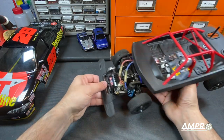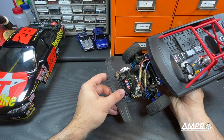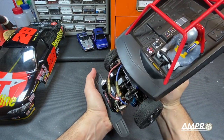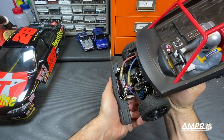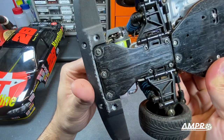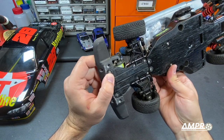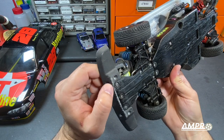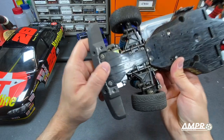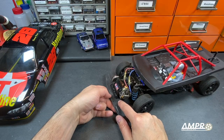Once you've done that, the bumper will clear the motor heatsink if you have one, and it will just slot directly over this plate here. It is not going to be a loose fit. It should be very nice and snug, and just giving it a nice little squeeze here, you're going to get all the holes to line up there and there. This hole is large enough for an M3 screw head to fit in here without a washer, and to sit sub-flush. This way, as the bumper is hit, the screw head is not deteriorated like used to happen on these 3 screws. You'll go ahead and put a nut on the top side here, and that'll be it.